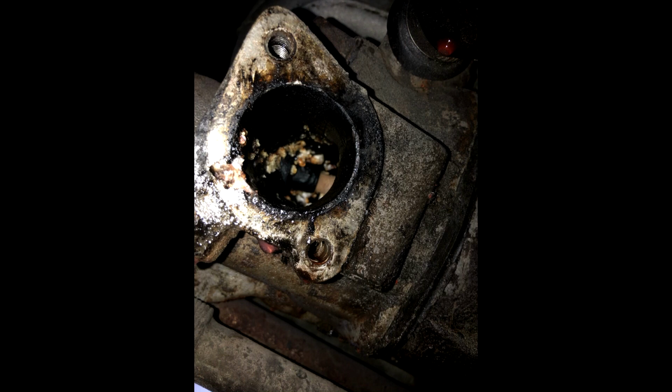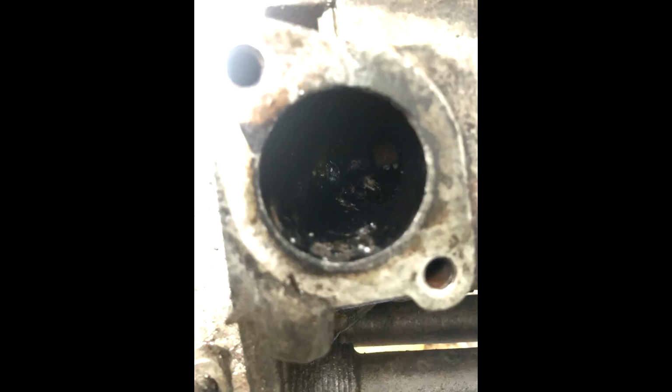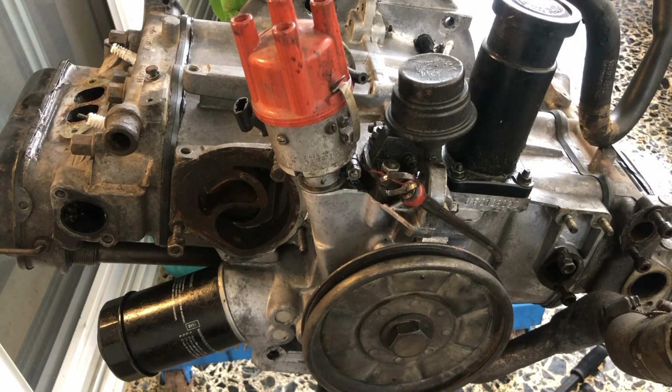Everybody, as I noticed that my van was losing coolant and I also had low oil pressure, I decided to rebuild the engine. After disassembling it, or starting to remove it, I noticed that the exhaust ports had cracked, which caused coolant to leak into them, which explains the coolant leak. Except this, the aluminum was swollen under the head gasket, which caused another leak.